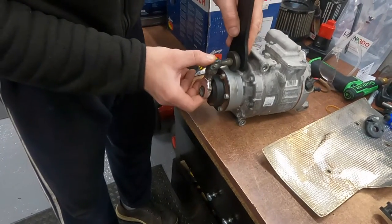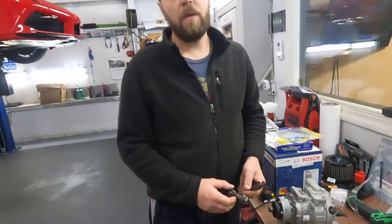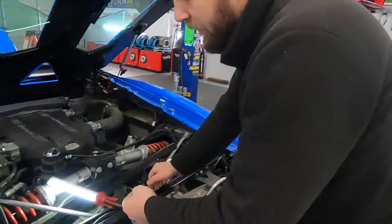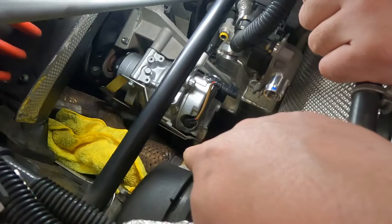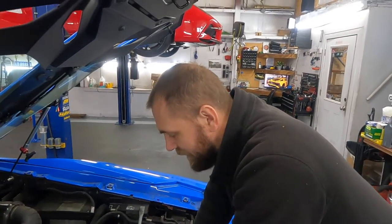When you install it, you just spin — of course you have to ask somebody to help hold the special tool. It's way easier to remove the AC compressor. Then just three more bolts right there and you remove it. Without that tool, if the bolt is locked, it's a big big problem and takes a lot of time. Now it's way easier. It's almost back in — just need to re-torque the bolt and re-torque the pulley. And done.